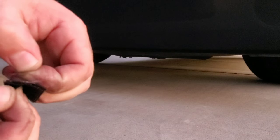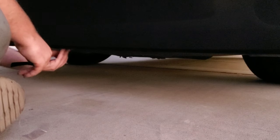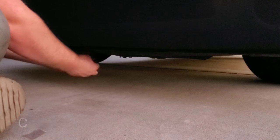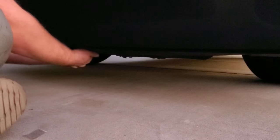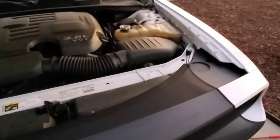The last thing we need to do is put on the Velcro. Now that the bra is evenly spread across, the Velcro will line up directly in the middle — that's what I recommend. Don't put the Velcro on before the Novi Stretch is folded on. So you're going to peel the adhesive, find the center where the Velcro is on the Novi Stretch, line it up where you want it, wipe the area clean, and put it on. Now the Novi Stretch is fully installed.